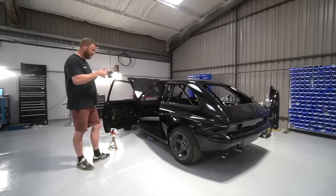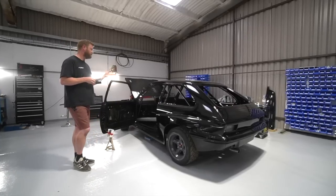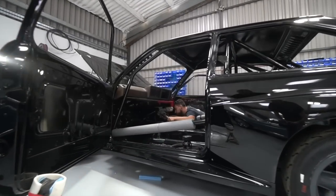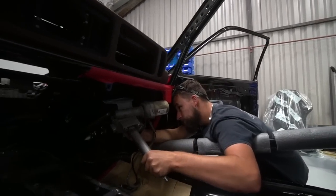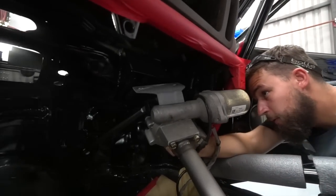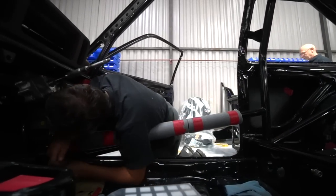There's also going to be some CAN bus button pads on the steering wheel, and we won't be having any stalks at all, so that relates to a job Scott's been on with this week. He's been remaking the upper outer column for the Corsa electric power steering unit that's in it. So it's a Corsa B electric power steering module, and the upper column normally has a plastic piece on the top, which is the column switch gear, and it also holds the upper column bearing.